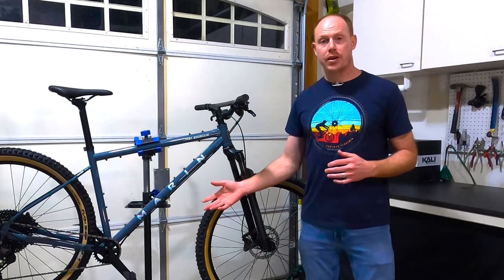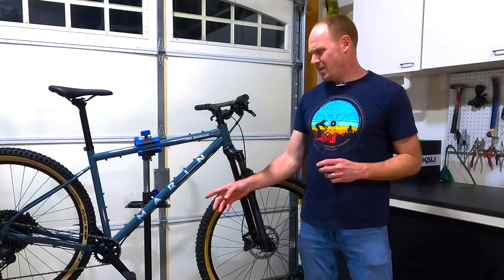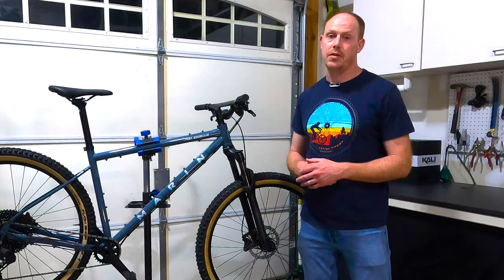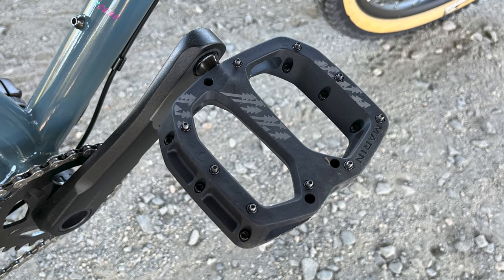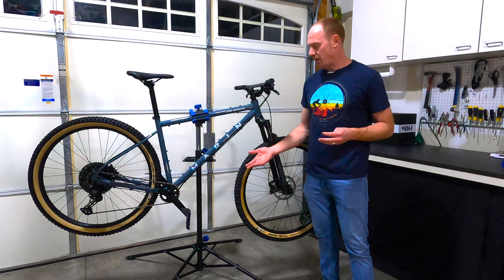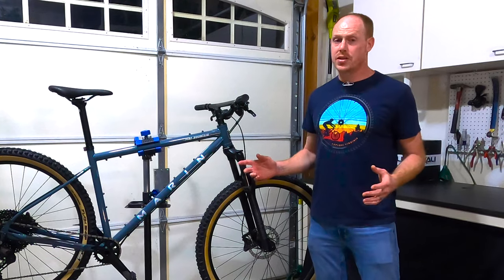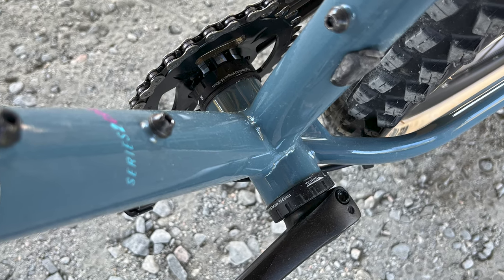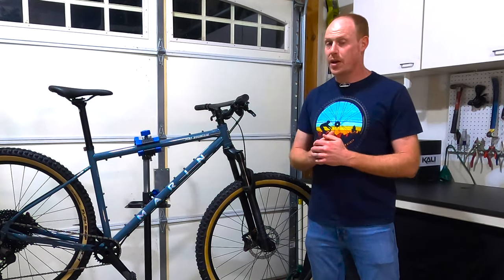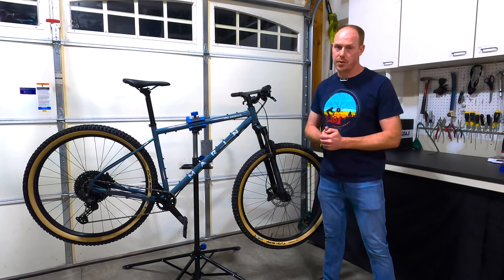For the rest of the drivetrain, there's a Marin-branded crankset — for most sizes that's 175-millimeter crank arms — with a narrow-wide single chainring up front. It's a bit chunky-looking and probably not the lightest since it's steel, but a narrow-wide chainring is really all you need. Attached to those crank arms are a set of Marin Oso pedals — composite with metal pins — though they're an aftermarket add-on at around $55. One really nice detail is the external bottom bracket with sealed cartridge bearings: it's smoother and much more lightweight than a square-taper bottom bracket.